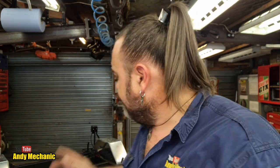Right, I have done the same on the other side of the trailer. So we've now got the wiring for all the lighting laid on the trailer, sort of zip tied roughly in the right place, giving it plenty of spare. It's way too easy to lay it in and not actually run the cable or leave enough cable slack to run it nice and neatly around the chassis. So I've gone back, double checked it, we're all good.